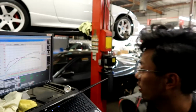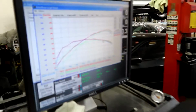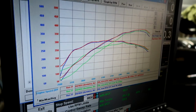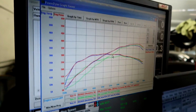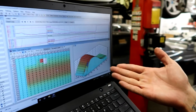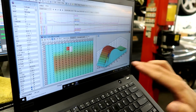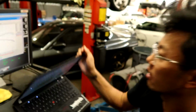That's interesting. So that brings us to this red line, which is the final optimized power graph. I'm making the most out of all the cam timing stuff. I see. So that's blending them all together. That is all of them, where it's changing through the rev range. And then at the end, it looks like this. Picking and choosing where I want it to be, and then making sure everything's nice and smooth, and the transition's really good. Nice. So, yeah, cam timing.